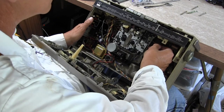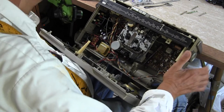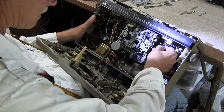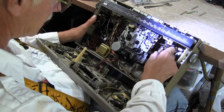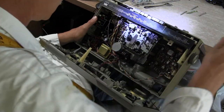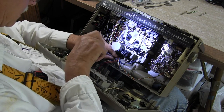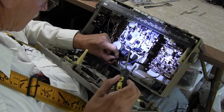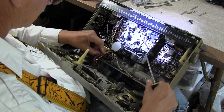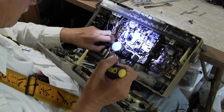This black wire right here — let me get a headlight. There's a long running conversation about why I use a headlight even though I've got all these lights on, but it's hard to see into the thing. Right here, just next to the antenna, here's the antenna wire which is a white wire. This is the ground winding wire which goes to the speaker — you just un-pull that off. Since this has never been worked on, I need to undo one of these wire guide mounts. There's another one on the tape deck corner. Now I've freed up those wires.